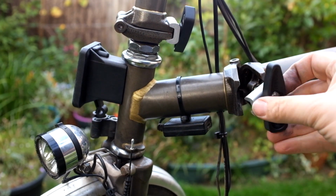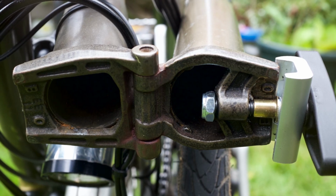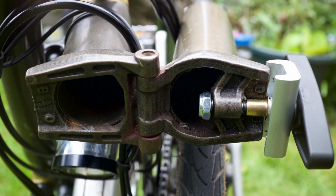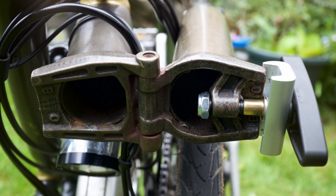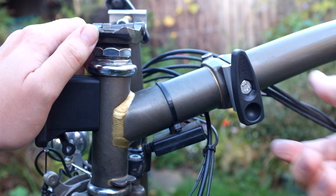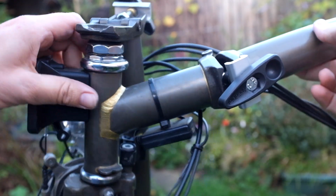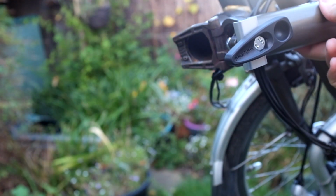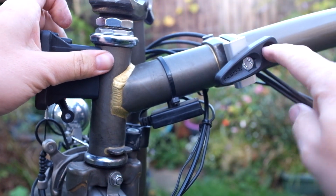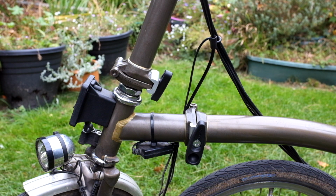You then undo the bolt, fold the bike and add the locking nut. Adjust the locking nut so that it prevents you making any more turns to the bolt when the bolt is loose enough to be able to fold the bike. An optional step after this is to realign it so that the handles are in the desired position when it's fully tightened, but I don't have a desired position, so I'll just skip this bit. Here's a demo of the complete folding and unfolding with the new SpēdDial clamps.